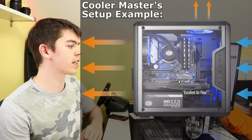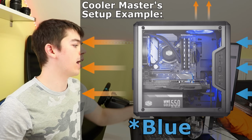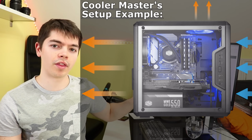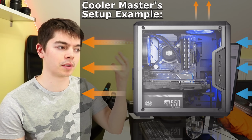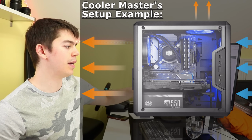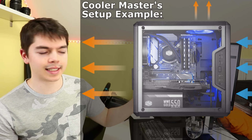So the power supply unit and the graphics card are potentially competing for around about 10mm of airflow headroom. We don't see a green arrow pointing up for the power supply unit, so we can only presume that it is having its intake from the interior of the case, which means it is definitely competing for air with that graphics card. So that is a very poor setup. We know from the CR280 test results, which was a mini ATX test case, that it's a very poor system setup to have the power supply unit and the graphics card so tightly together. You're basically inhibiting half of the airflow of the graphics card and the majority of the airflow of the power supply unit. But you'd go fan side down surely, but they haven't presented that.